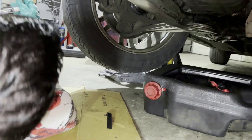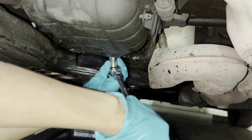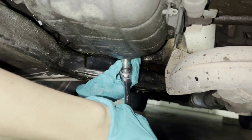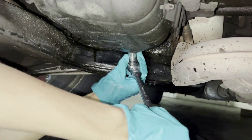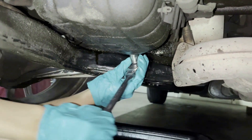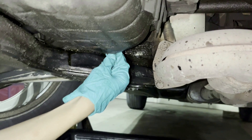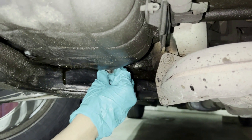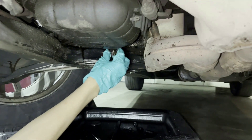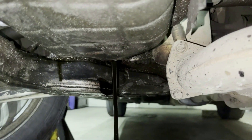Now comes the part where he might get a little messy, but somebody's got to do it. We have a 14-millimeter socket and he's going to get on there — I've got a swivel head on that ratchet which helps. Some of these are super tight. Once you loosen it, you might be able to start turning it with your hand. Be ready because it's going to come squirting down. When you feel it come off completely, just let the bolt drop — don't try to hold it or you'll really make a mess. He did pretty good.